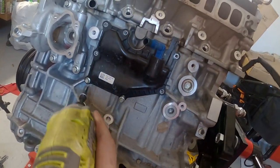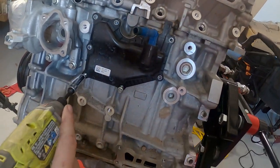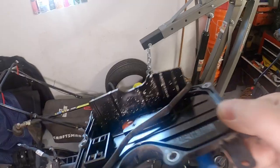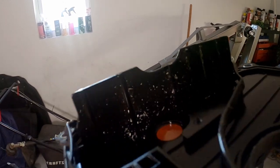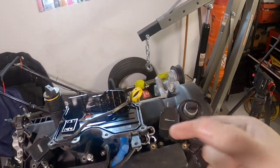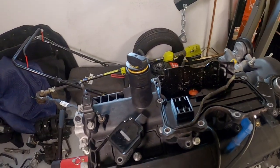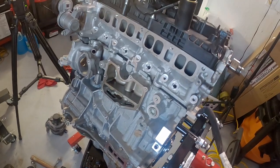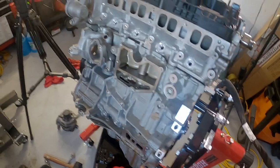Let's go ahead and finish getting this crankcase breather thing off. Oh no — you see what I see? More confetti trapped by this thing. It was like a baffle it lays on. I'm hoping that a lot of this stuff has trapped all these little bits of metal from going through everything. I did put the larger oil filter on, so hopefully the larger filter also caught a lot of crap before it circulated too much. The important part is pulling that pan off and we'll find more out.